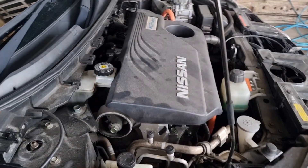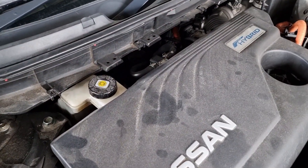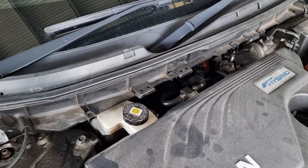Once I clear the code it comes back immediately. When I try to manually request the motor to work using the scan tool, nothing happens either. So I think we're having a motor problem. I need to check that the motor is getting the proper signal and see if it's working. Opening up the front — the electric motor and accumulator belong to this unit in the back, so I'm going to have to take all this cover out and check the signal.